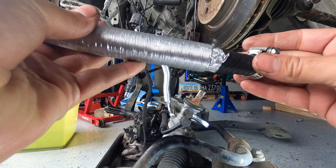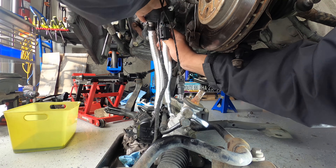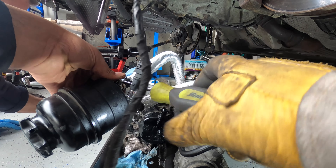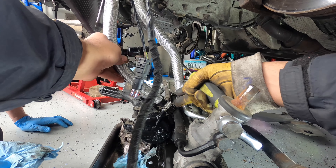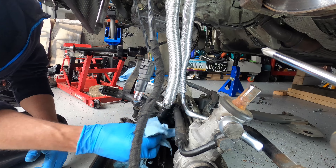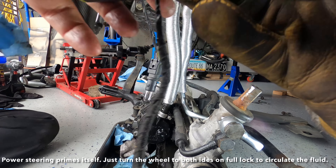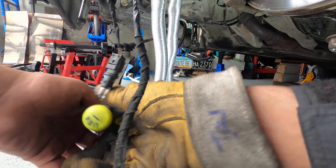We're going to put a new clamp at the bottom and the top one as well. I would like to say just put this on, but this thing was a beast to put on — be ready for some effort, the high-pressure hose is a very tight fit. Now we're putting the other hose back on. I tried to connect the return hose first and it didn't go very well because they're slightly offset. Now both hoses are on, we can clamp them and then put fluid in the system. Dropping the subframe is the easiest way to replace your power steering hoses.